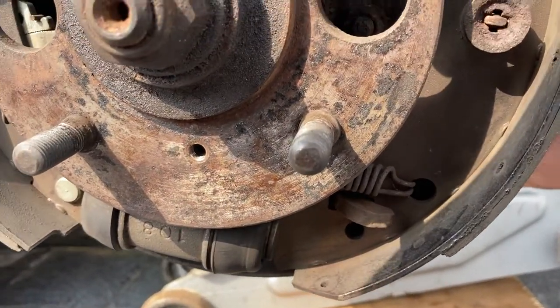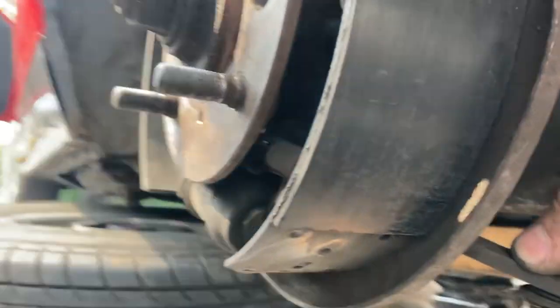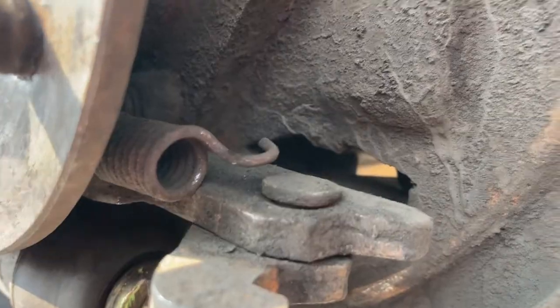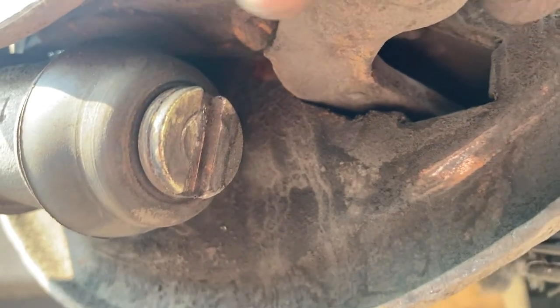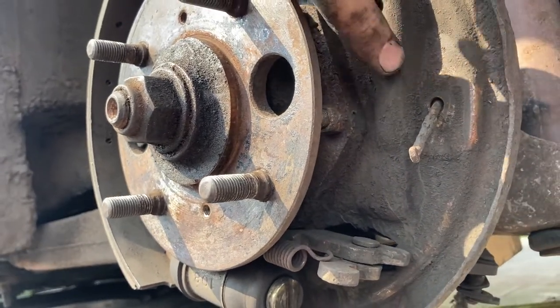I'm doing a rubbish job with the camera, but there's something worn here - it moves up and down too much inside there and it's missing a pivot. The hole the handbrake lever comes through is completely worn away. If it sits at the top of the hole, that lever has enough leverage. If it falls down to the bottom, it's not pushing against much at all - so yeah, it might need a whole new back plate.